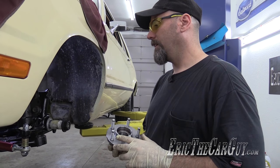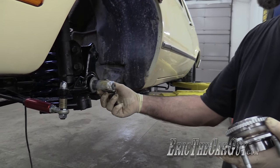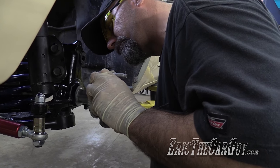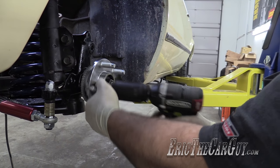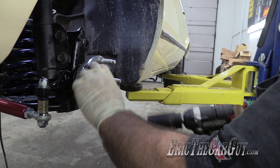I'll need to put this on first — something I thought of. I don't have a splash shield for this, but I'm going to look into it, so I may come back and install one. Remove this and the protective covering. That little bit of grease on there should just slide into place. 35 millimeter. Now before you get your panties in a bunch because I didn't torque down the spindle nut, the torque spec is 221 to 295 foot-pounds or 300 to 400 newton-meters — pretty stinking tight. I don't think the impact actually achieved that, but I'm going back to fix it later. So calm down.